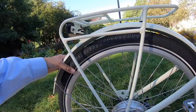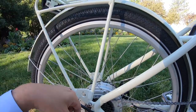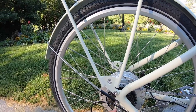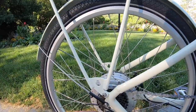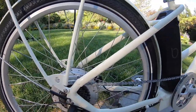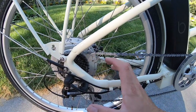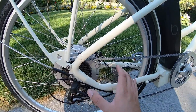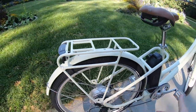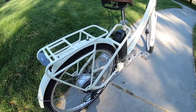On the back of the bike, you have more or less a mirrored set from the front — same tire, same wheel. One difference is the axle: it uses 18-millimeter nuts on both sides rather than a quick release, due to the motor. To change the tire, you disconnect the motor connector, remove the nuts, and then you can change it like a regular tire. It's not all that complicated, but it can be intimidating. The shop can help you if you need extra help in that regard.